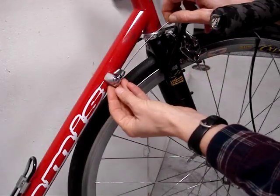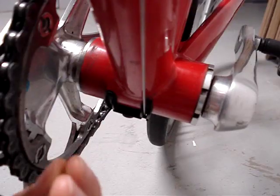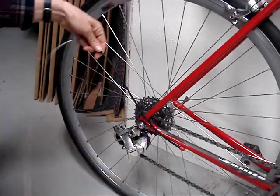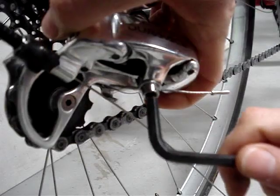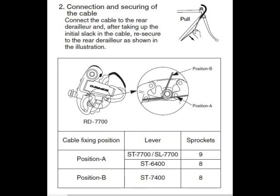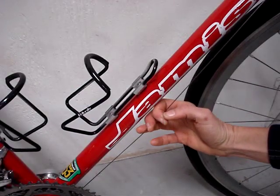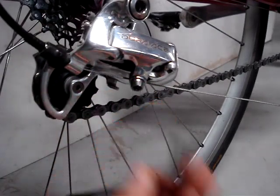Make sure that the cable head is fully seated inside of the shifter. Once the new housings and cable are installed, I'll show how to use the barrel adjuster to put the correct amount of tension on the derailleur. If there is not an adjuster at the derailleur, look for one at the shifter. Before removing the old cable end, take note of its position — this derailleur has two possible positions depending upon which shifter is used. To give the cable a little bit of stretch and to seat all the ferrules properly, give it a tug, then take up any slack created at the derailleur.